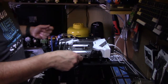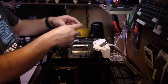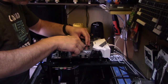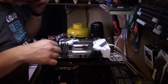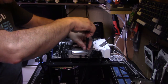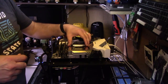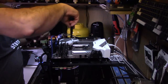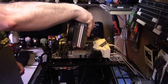The back plate is now attached to the motherboard. Next we have to put the top plate on and screw it down — I'm going to put the screws in but not tighten them all the way yet. Now the plate is on I'll tighten it fully, but at this stage I'm going to check to make sure the cooler won't hit any VRM cooling or anything. Looks like we're good.